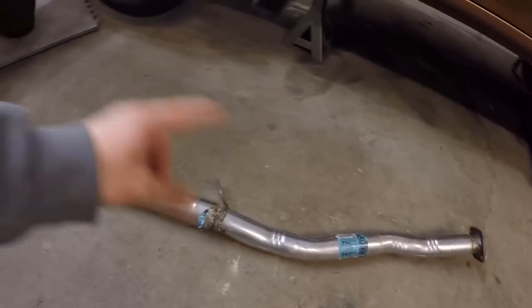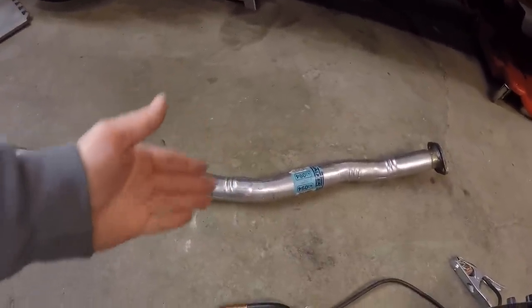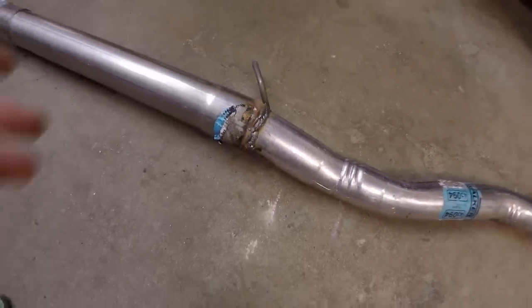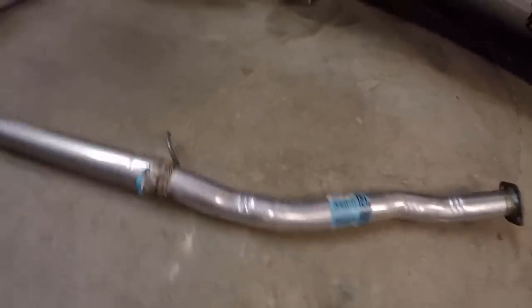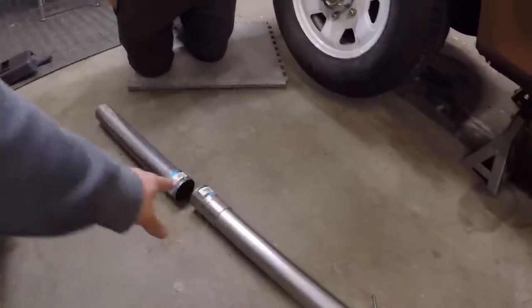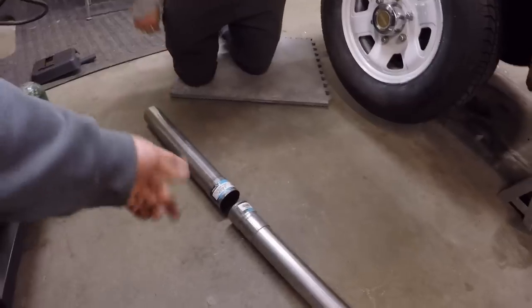We got the mid pipe here - it is now welded up to this section of pipe. We had a little bit of a challenge because this pipe is about inch and three quarters and then this pipe here is two inches. The welds on there are definitely booger welds, they're not the prettiest - I didn't really clean it or anything, I just stuck it together. It works for now; this isn't a permanent engine or anything so it'll work for now. Next up we're gonna weld this section here which should be much easier - it's two inch to a coupler to a two and a quarter - and then that'll connect to the muffler.